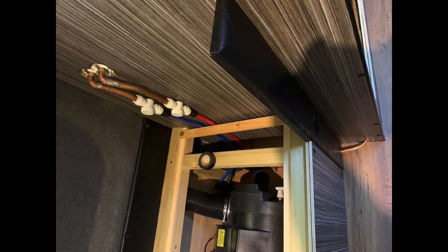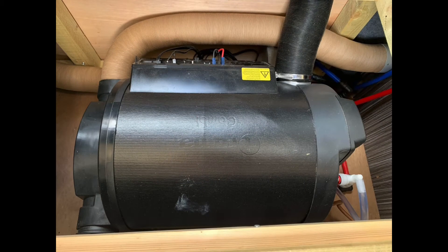This is an awkward picture but it's actually the John Guest fittings going on to the back of the shower unit - for the shower in the bathroom. I wanted to make sure before I boxed all this in that there were going to be no leaks, because once it's boxed in, unless you take the panel off, it'd be a nightmare to make any changes. So I checked the pressures before I boxed this side in. There's the Truma - it hasn't got the rear panel on yet.